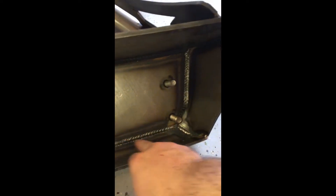Here's a look on the inside — these are things you wouldn't typically see on a bumper. See how they fill-weld there. It's stout. That's up inside where the winch is going to mount — that plate's not going anywhere. Even the fog light mounts, they're not going to go anywhere. Everything is beefy. You can see the slight coloration, which tells me they've welded that on the backside too. So those are stout and sturdy. A good-looking bumper.